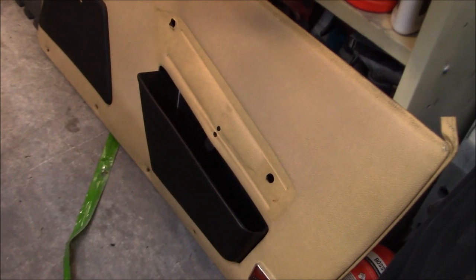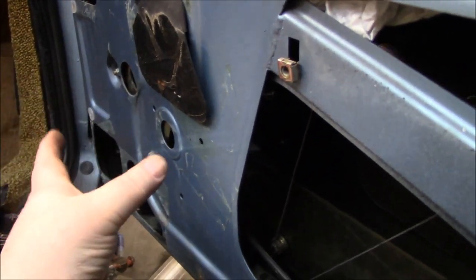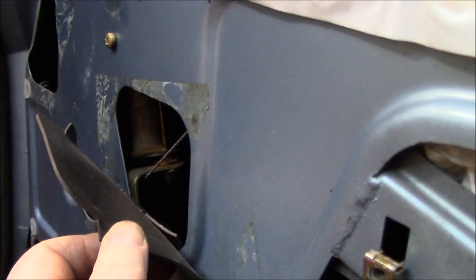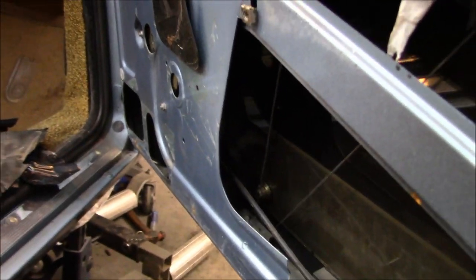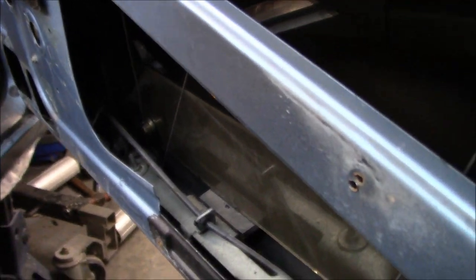There is the door panel down there, and as mentioned the door pocket stays on. The back of the panel actually looks to be in pretty good shape - you can see the mounting tabs there. Looks like the original masking tape is coming off the bottom that covered the staples, but looks pretty good. We just removed all of the black tape that was covering over the holes here, and we've got a little bit of a rubber gasket or grommet here which gets to the motor for the power windows. Let me grab a flashlight - I want to show you the door bottoms and have a look at the cable mechanism for the door. Here are the points that I want to lube, here on these rollers for example.